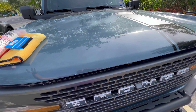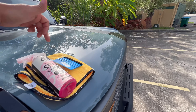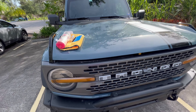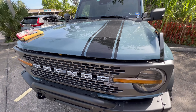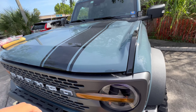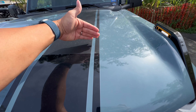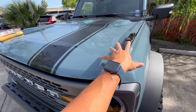Even once you take it to a car wash and get to your install location, make sure you have that microfiber, that speed wipe that doesn't have any wax, and our application fluid and a squeegee. Do this with two or three people total, because you want to take this off the backing paper and then spray that Sikafab application fluid. Spray it all on the hood, the entire application area, a little bit beyond here even, because you're going to use those two people to center it up.